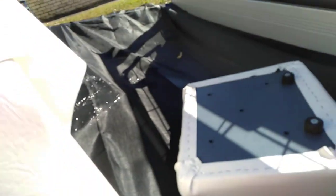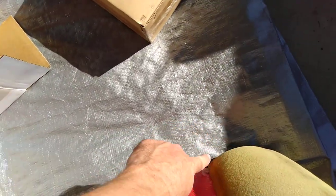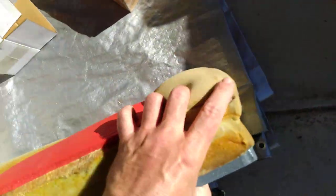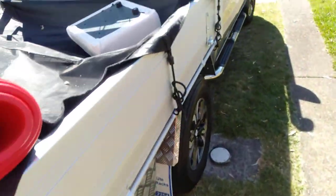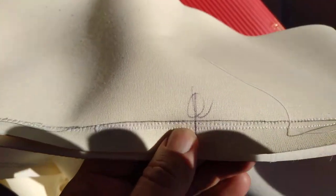I've got some of this marine vinyl. There's one of the seat bases. Basically I just got the vacuum, took the old seat when it had the cover on, stuck it on like that, drew around the pattern, rolled it forward, drew it around again. So I just came up with one length — from here round to the front, back down the side, and then same again. I just lay the pad on the material, drew around it, cut it, stitched it — Bob's your uncle, Fanny's your aunt.